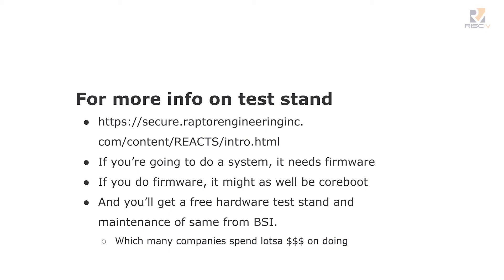My reasoning here is: if you're going to do a system, you need firmware. We've talked about the architecture and specific CPUs, but firmware is about the stuff that's not the CPU. That stuff is always complicated, it always has bugs. Linux actually doesn't know how to turn this stuff on because it's generally not dropped into a system with this stuff off — Linux can't actually configure non-configured PCI interfaces correctly. I view it as a necessary evil. I want it to be gone when I'm done booting — that's the model I believe in.